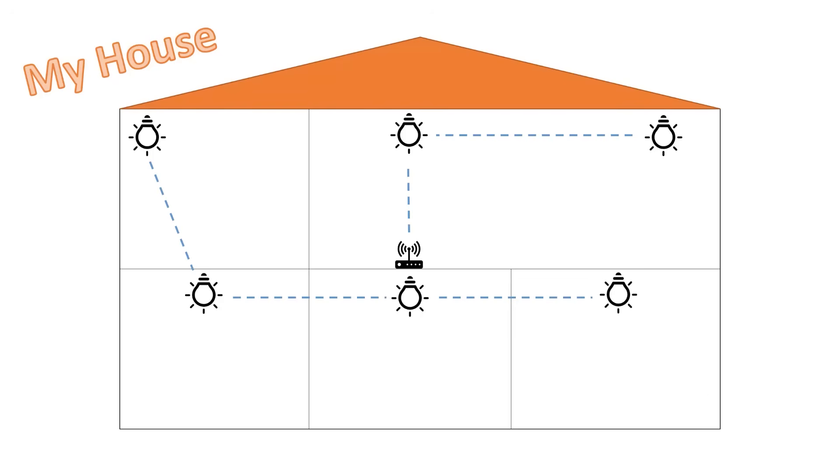When I paired these devices the first time I used to do it near the coordinator in my office and then move them to their final resting place. This turned out to be a stupid idea because they would pair with the router or coordinator in my office, and when I moved them out to the kitchen or wherever, they'd lose connection. I now re-paired the devices in situ where I planned on using them so they would immediately connect to the closest router. This whole process was a massive pain but took me several hours over the course of a weekend, and it really has made a big improvement to the performance and stability of my network.